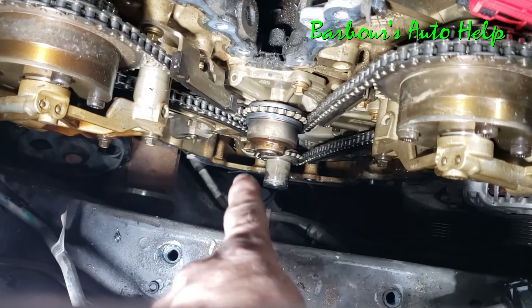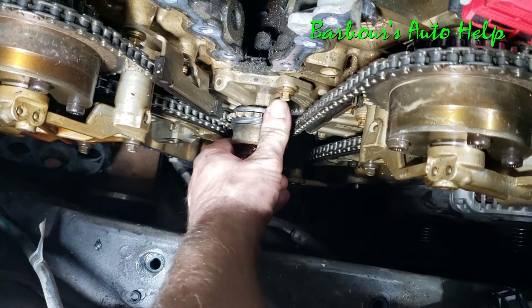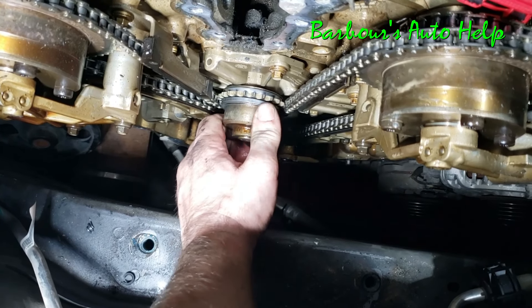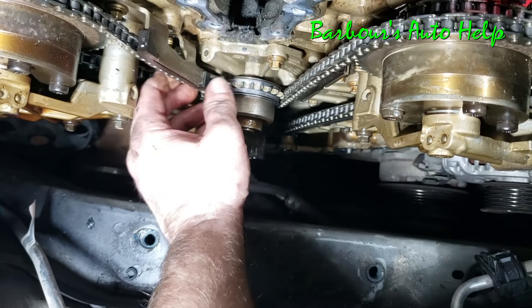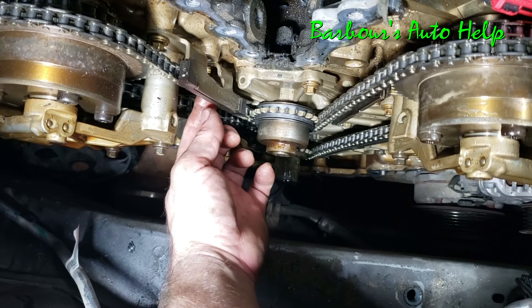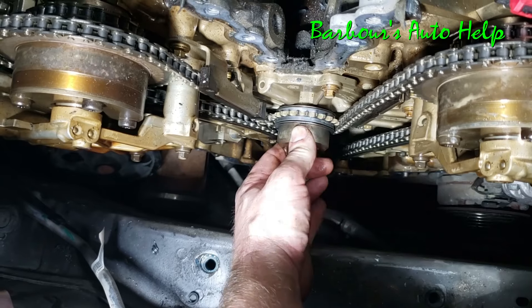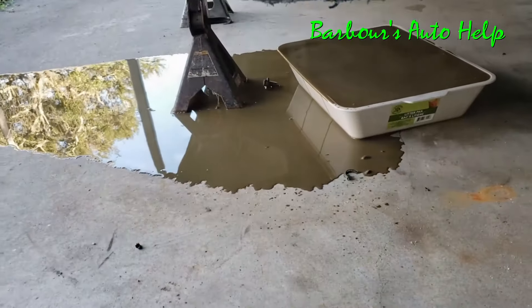Here's another example — this is on my own engine. My water pump went out catastrophically. The bearings fell inside and the pulley is just flopping around. So instead of the coolant weeping through the weep hole, which it was doing for a very long time — there are some snail trails on the side of my engine — it went out catastrophically. All that coolant came out through the shaft and got into my engine oil. So here I am.